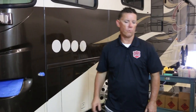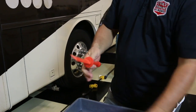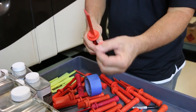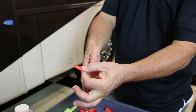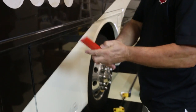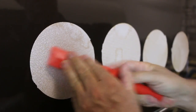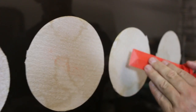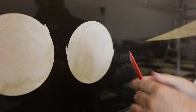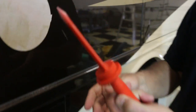Why this is so important — we want to take our plastic chisels. I like the fat wide one out of the four sizes, and they come in a four-pack. We get them from Northern or you can get them at Harbor Freight. The scraper has to be straight, smooth, with no edges and no gouges so we don't scratch the paint. We're going to start with the 80 and rebuild this scraper, then go down the line: 120, 220, and finish with the 320. We also make sure it's squared — that's especially important with Diamond Shield removal. And now it's ready to go.